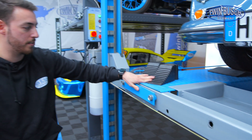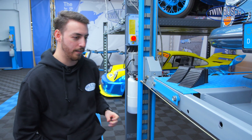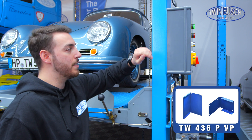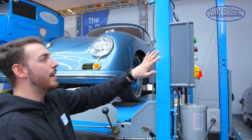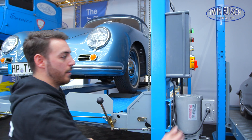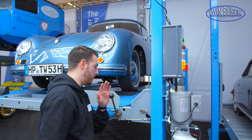These wheel chocks are also included; I can place them in front of or behind my wheels to protect the car from rolling. There are also optional accessories — we offer so-called angle plates, which allow me to displace the control unit and motor to the front, saving exactly 24 cm on the side if space is limited.